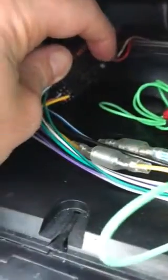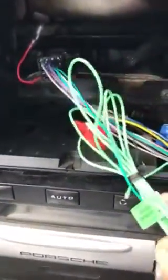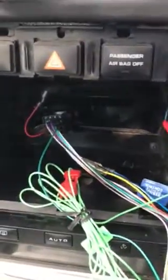These ones here, the brown and the black, are the existing ones that came out of the old PCM2. There is a third connector, but I've tucked that up and out of the way. This green cable I've got to earth. This is one that's supposed to go to the parking brake, but I can't be bothered to try and find the grounding point for it, so I'm just going to ground the wire off. I know safety says you're not supposed to do that.